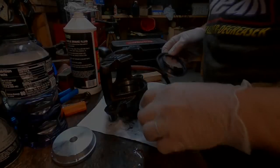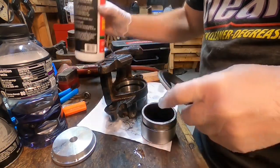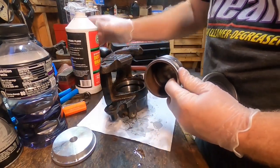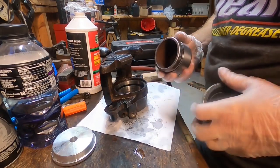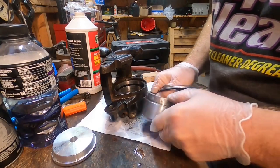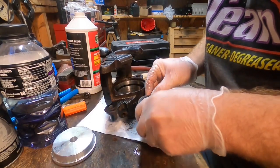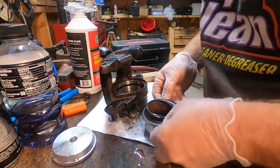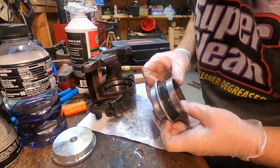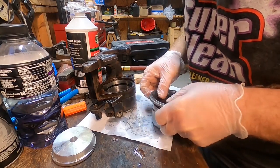That was hard! We're going to get the piston installed next and the dust boot around that. A little fluid on that guy, and we're going to get this inner lip of the boot down into that groove right there in the piston. Hopefully that'll be like falling off a log. All right, there we go — now we're going to bring that up.